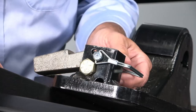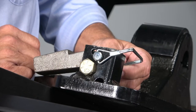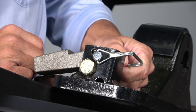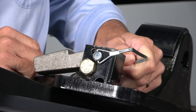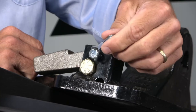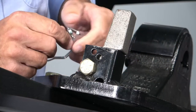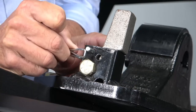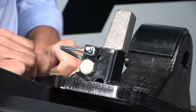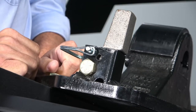Now we're looking at the front block on the no-tilt fifth wheel assembly. Notice the pin here — it's a retainer pin, retained in the assembly all the time. You don't have to store that anywhere. To set your block to no-tilt, you remove the pin, put the block to the up position, and replace the pin so it retains the block in the up position. This keeps the fifth wheel set with no articulation.